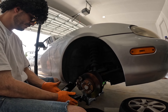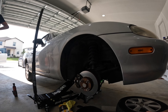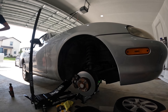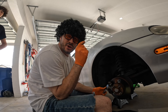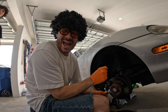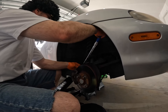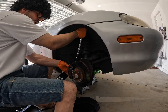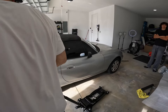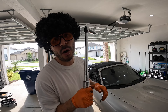I need my torque wrench. Does 26 meter-pounds sound better or 64 foot-pounds? Whatever the actual spec is. For the slider bolts, you're going to be torquing these down to 23 to 28 foot-pounds — muy importante. Let's get it done. I had to hand-tighten it already to torque spec — look at that. Let's go ahead and do the other side real quick. According to spec, the lug nuts are 80 foot-pounds.